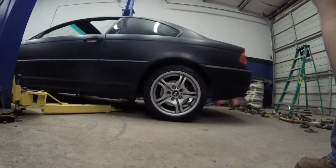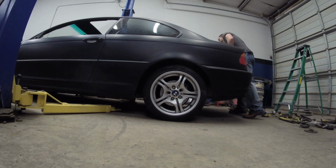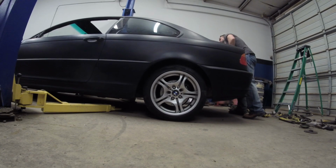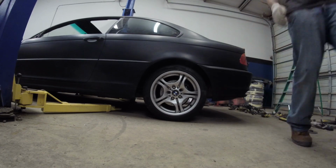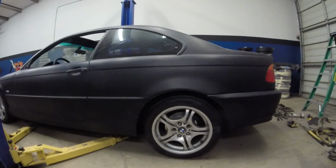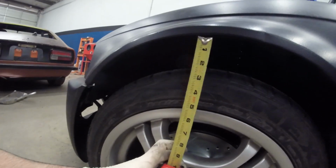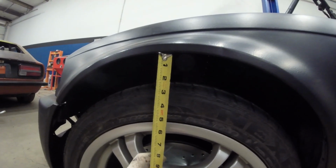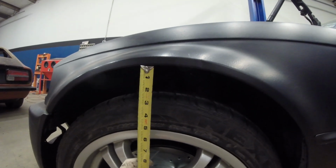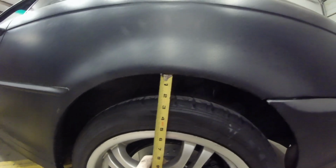Now when you drive it, it's gonna settle the suspension, but the rear end of this vehicle definitely needs to get a lot lower, and I have them on the lowest settings, so I don't know what else to do on that. Let's see. Yeah, about 2 inches would put me pretty close to where I would like it on the front. So I have to lower that front end 2 inches down on the sleeve. And this right here, about the same, 2 inches.